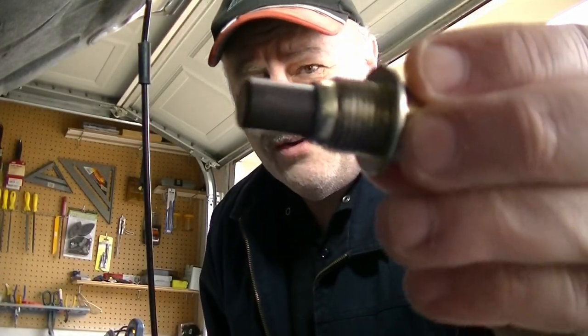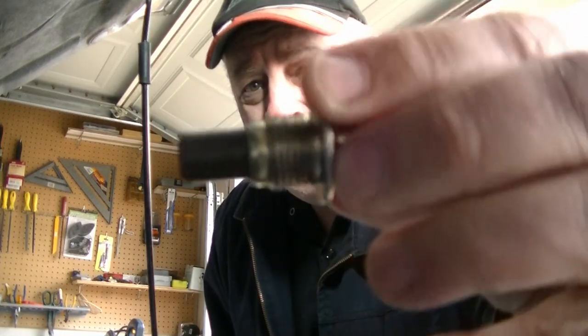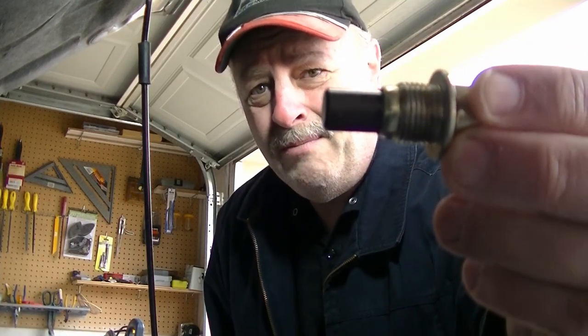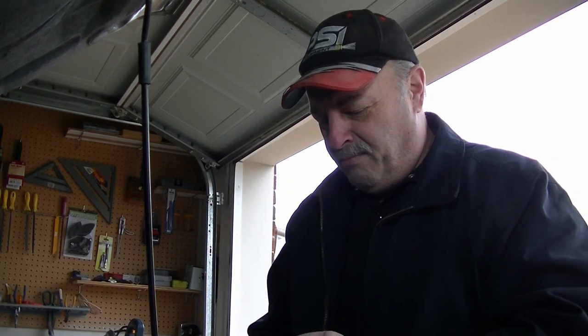Anyway, there's the bolt. You should be able to see that right there. Those threads are 12 millimeter long, and the whole bolt's about 30 millimeter if you go to the end of the magnet. Thanks to the suggestion of Eric, the car guy, sorry, don't want to misbrand your channel, he was dealing with a 14 millimeter. I've got to deal with an 18 millimeter, but the concept's still the same. So I got a 30 millimeter, the smallest they had, of a metric 18 by 1.5 pitch.